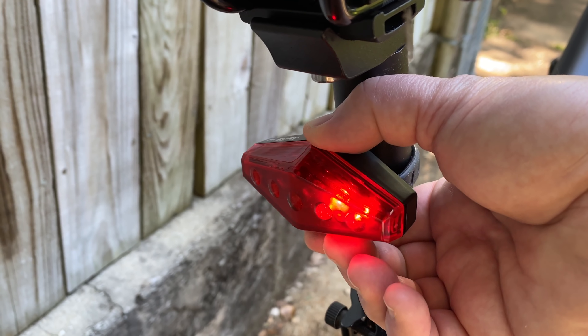I also had to get an unlock code because the wheel size was set improperly — every one kilometer registered on the odometer was actually only 0.7 kilometers traveled. Once I made the adjustment it seems fairly accurate within one to two kilometers per hour. The bike has a throttle, plus five pedal assist modes: mode one gets you up to 6 mph, mode two 8 mph, three is 12, four is 18 mph, and mode five — max pedal assist — is 25 mph.